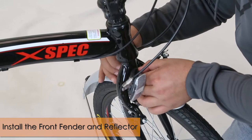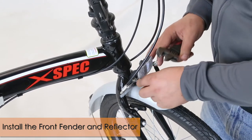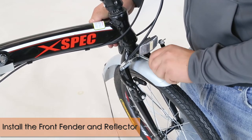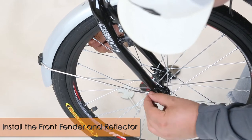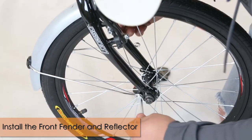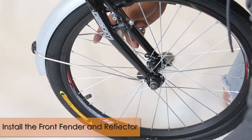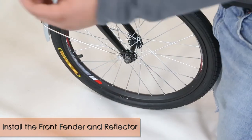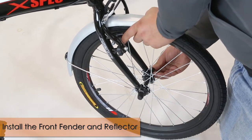Tighten the nut on the other side. Get your wrench and a screwdriver and make sure you tighten up the screw. Make sure the fender is aligned properly, align it with the hole, then get your screwdriver and do the same for the other side. These black plastic pieces are for the nuts from the front wheel and the rear wheel — you can insert them right here if you like, it's optional. You get four pieces total, two for the front and two for the rear sides.